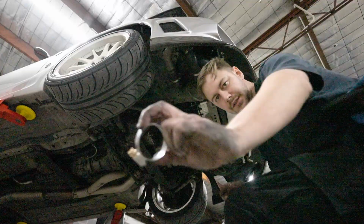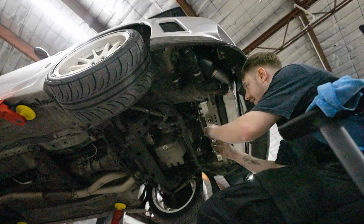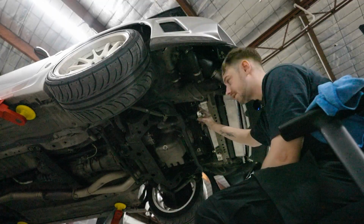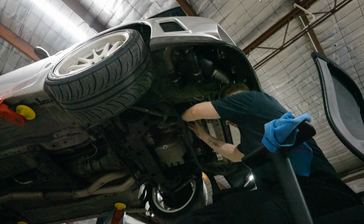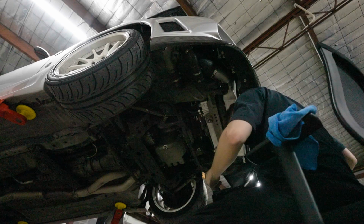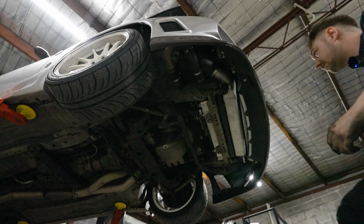All right, so fastener on first. Probably gonna have it facing inside down, so it's away from the sensor, because there's a coolant temperature sensor that goes in the bottom there. So have it down like that, and then let's get that bottom hose on. That went on quite easy, thankfully. And then let's tighten that down. All right, so that's the bottom one done.